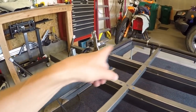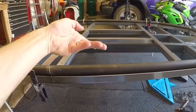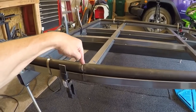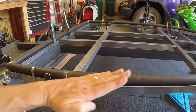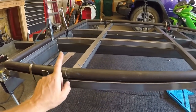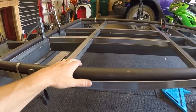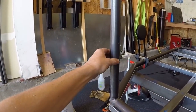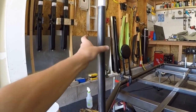When I had all of the pieces tacked together, I actually took the frame off, flipped it over so it was upside down, clamped it down again, and then put tacks on the bottom just to give it a little bit more rigidity to help it fight from trying to bend up. Once I put those tacks on, I unclamped everything, flipped it back over, and now it's in its upright position. Once I had that portion of the base chassis done, I started working on the three-dimensional portions of the chassis, and this is the first piece of that that I've tacked in place.